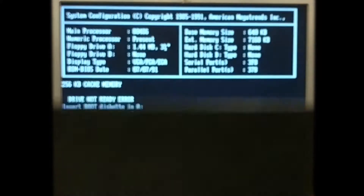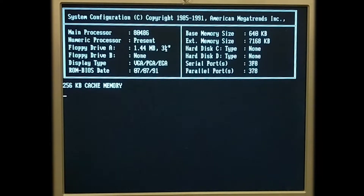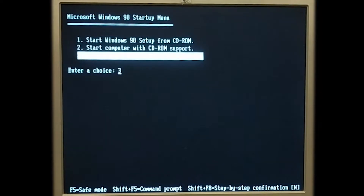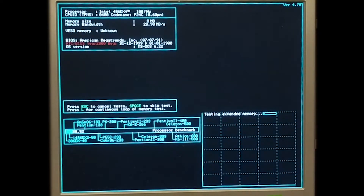Is it plugged in upside down? I got the right position on the cable because it's reading the right floppy drive. That is eight megabytes of RAM. This is a Windows 98 boot disk. I ended up pulling out my GoTek and swapping it in. I tried SpeedSys and the results were dismal. Then I realized that I had the turbo button backwards — pushed it in, and all was well.